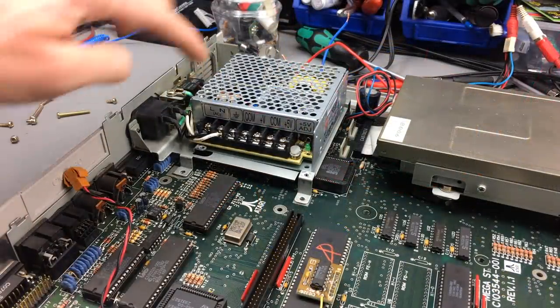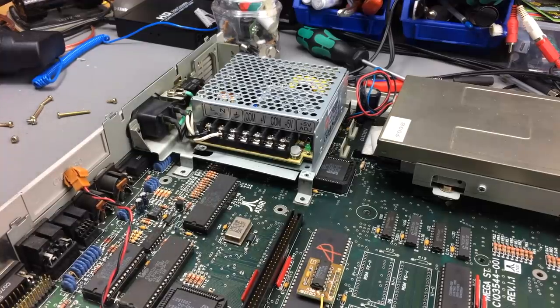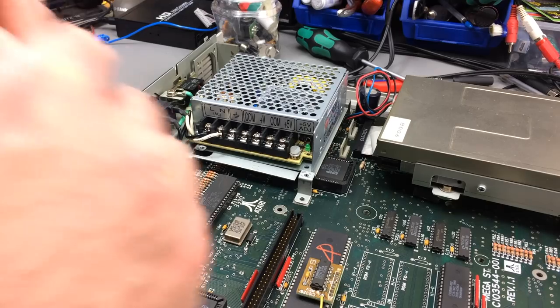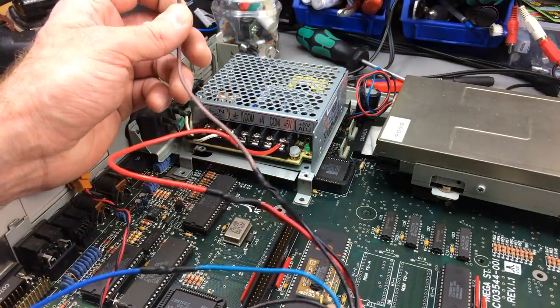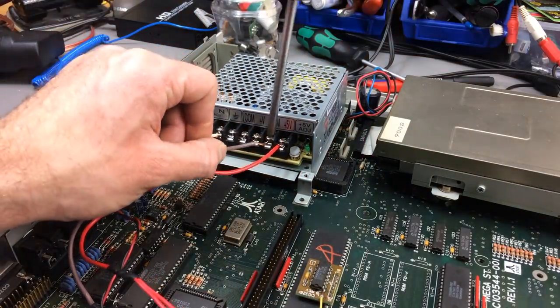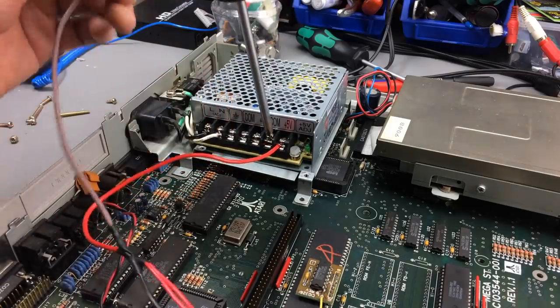So now we can connect these wires that we just made to our screw terminals. Ideally, that would be great. Okay, got our 5 volts here. Then I'm just using the ground that's closer to the 5 volts, where I connected 2 ground wires, as the common ground here. Which doesn't matter because it's all connected together anyway, I guess.